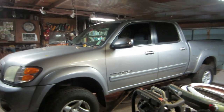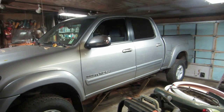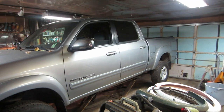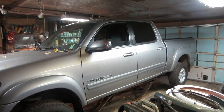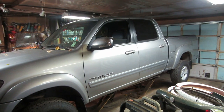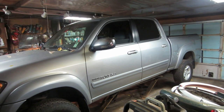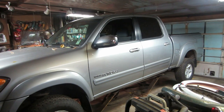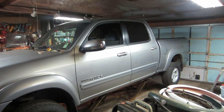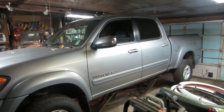A lot of people have been asking what's going on with the silver Tundra. When I picked it up it needed a rear end, and lo and behold a double cab uses a different rear differential ratio. An extended cab runs 3.91 gears, a double cab runs 4.10s. 4.10s are very hard to find for a rear axle assembly and if you find them they're very expensive — the carrier new is like $1,800.